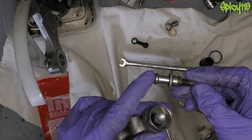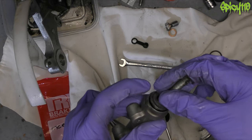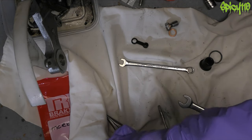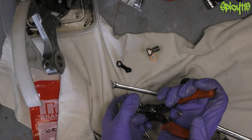So I've just cleaned up the pin. As you can see, this is like a dome, and there's like a dome in the bottom of the piston, and it sits in it. And when it's all pressed down, that holds the seals in place. So this might be interesting to get back in because it's going to be under spring tension. You've just got to hold that down and get the retainer clip over it.